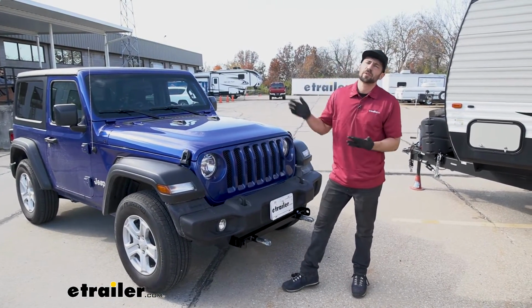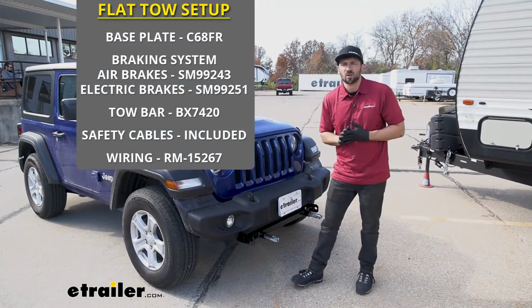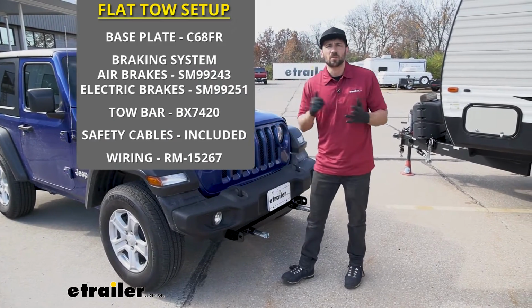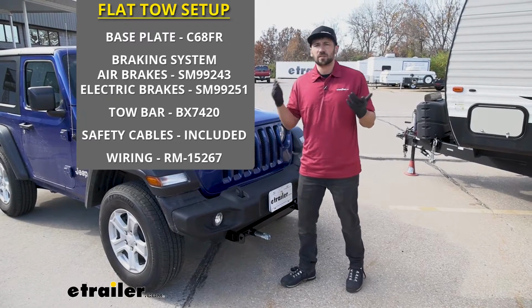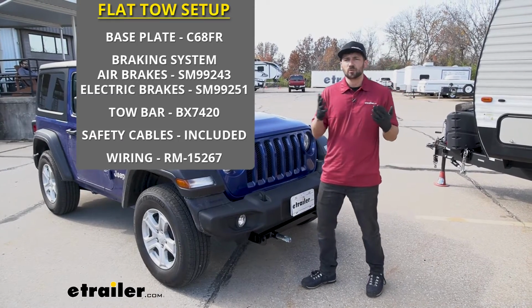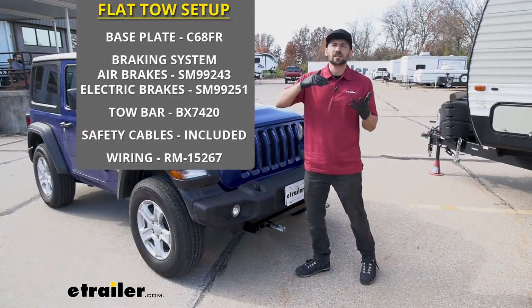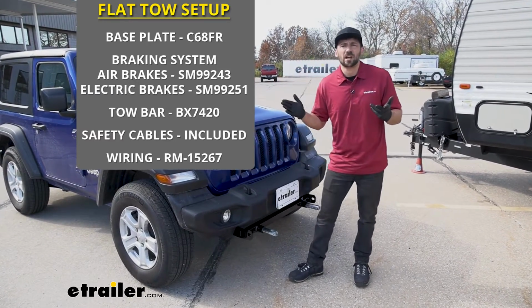There are actually a few other things you may need to flat tow the vehicle. A few of these things are, number one, a supplemental braking system. This is required in most states. It's not an actual requirement to flat tow, but many states do have a stipulation based on the weight of the towed vehicle. Some other things you'll need is a tow bar, which we already talked about, some safety cables, as well as a lighting system to power the lights on the vehicle to let others behind you know what your signals are.